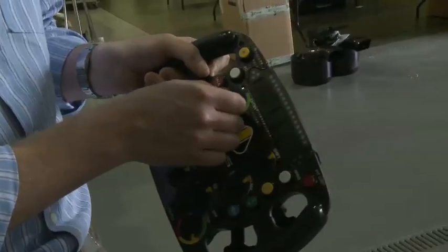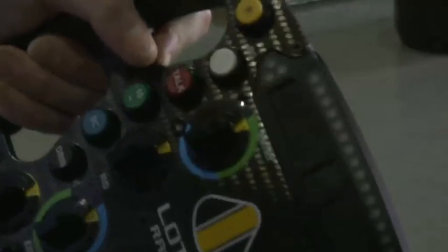Just stopping there — what changes do you make? Let's say you've got understeer, how would you change something on here? If you've got understeer you need to open up the diff at the rear, so from a higher position you'd probably slacken it off a bit. And obviously vice versa at the rear.